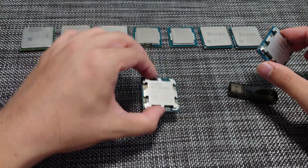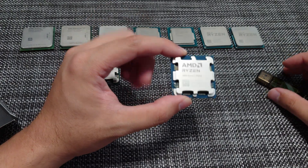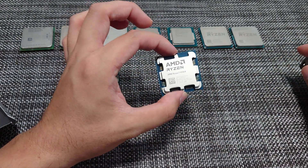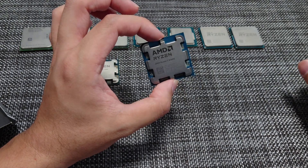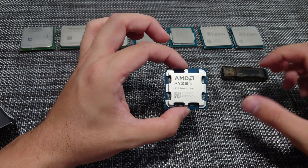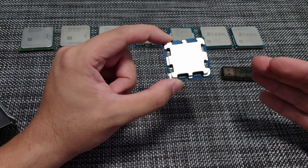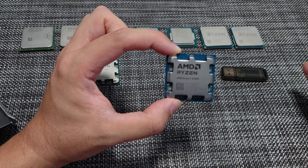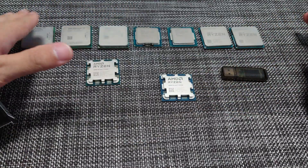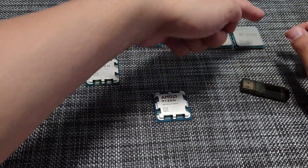If you're buying this new and picking up an older AMD motherboard — like an X670 or X670E or B650E — you need to be aware that unless you're at a Micro Center where boards already have the updated BIOS, there's no way of knowing if an online purchase has the newer BIOS from May of this year or newer with AGESA 1170 or 1200, which supports the Ryzen 9000 series. That's one thing to be aware of if you're upgrading from a much older CPU. This will be an amazing upgrade if you're on any of those older CPUs.